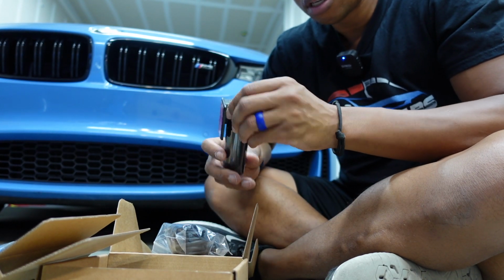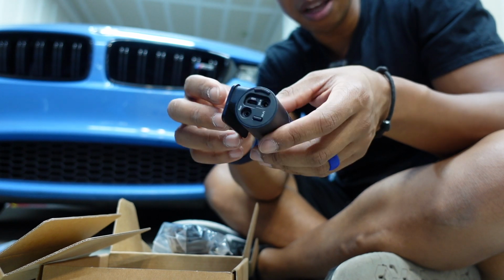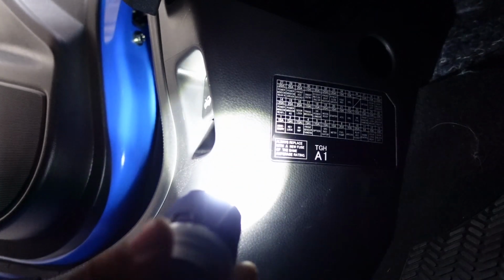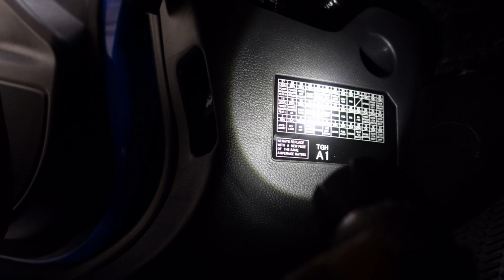All right, so step one, I'm gonna find an appropriate cord, make sure that our fuse comes on and it records when the car's off, and so on. We talked about it already. Let's go. Those who are wondering where the fuse diagram is, it's right there. So what we're gonna do is choose 2 fuses, because like I said, we need one that is always powered and we need one that's only powered when the car is on. So we have this one here, the number 1 accessory. That would be a good one for only when the car starts on.